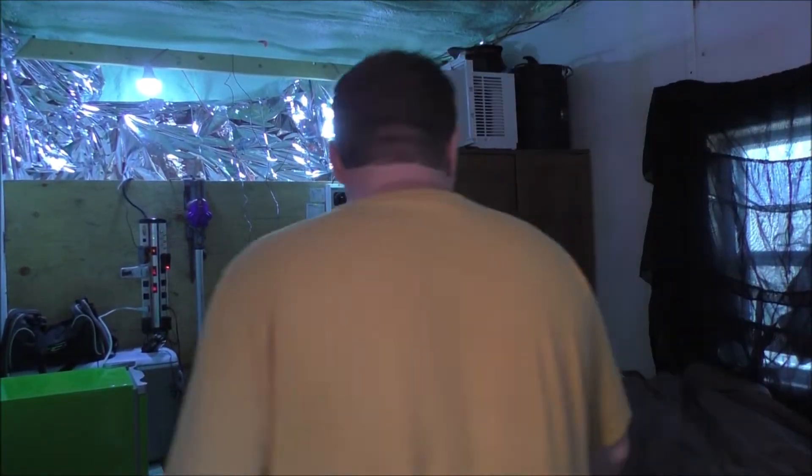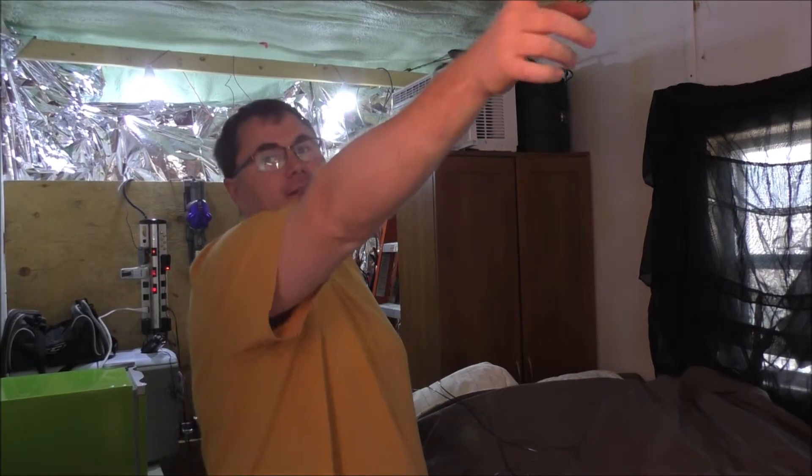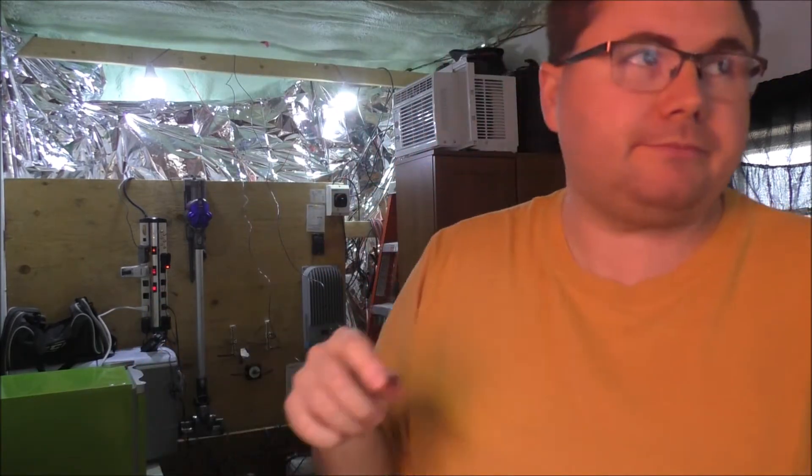What's going on is you guys have seen it firsthand — I don't have enough power over there for my pump for the rain catchment or the shower because those batteries are pretty much defunct. So what I'm going to do back here is hook up some wires to the heavy gauge wires that used to run this part of the trailer but are still up in the ceiling. I'm going to do a rewire back here and back there and basically make a little bus bar setup to send power from these batteries to run my pumps, shower, and lighting.